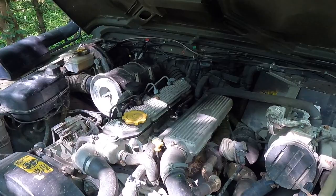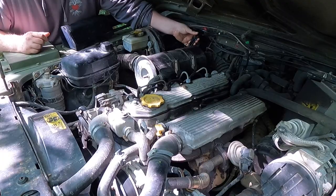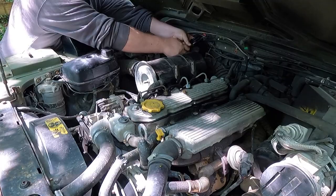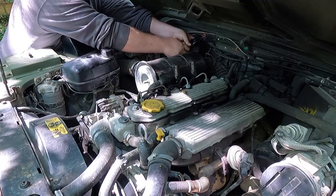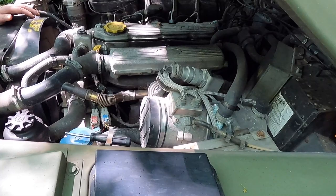The alternator has two connections — when you go wading you swap the red and blue connections over, removing the alternator from the battery power, so when it gets submerged it doesn't burn itself out. Over here are the diff breather pipes: blue pipe for standard driving, red pipe for wading. You disconnect the connection, slip it off, and quick-fit it onto that one — that sends the diffs up into the air intake.